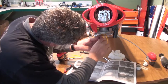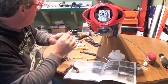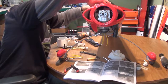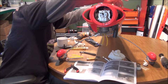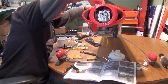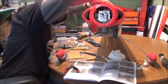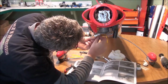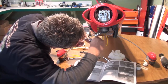On these cowl bolts, I'm not running them up totally tight yet — just running them up a little bit until I get all four of them run up a little bit. I've got two that come from inside the fuselage and two that bolt in underneath. I'm going to go ahead and tighten them just a little bit. They don't have to be very tight — tight enough to compress the heads of the lock washers. I put silicone on the threads, which should help.